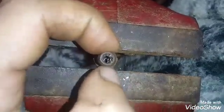The air vent was clogged up so badly I actually had to put the nipple in a clamp. You can see the shrapnel from the gears that got shredded up. This is the differential cover — someone had punctured or nearly punctured it multiple times, and it was totally punctured through twice. The prior owner had sealed over it with a bondo-type material on the outside and the inside. On the inside it had totally worn through; on the outside the seal was broken and the fluid had been seeping out. I'm going to do a fix on that with metal screws, washers, and epoxy, even though technically it should be welded.